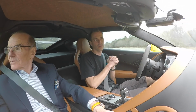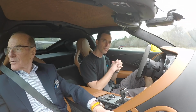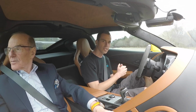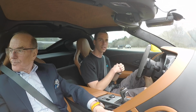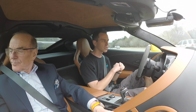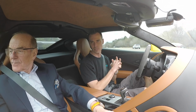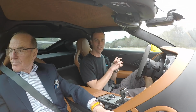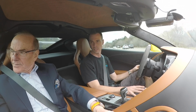The headers pick up a little bit, but when you don't turn the boost up much, you're really not gaining much from the headers. Just in my opinion, it just sounds 10 times better now. And then tuning it obviously helped tremendously. So we went from, I think, 607 to almost 670 to the tires, and torque is about the same. So we picked up about 60 or 70 rear wheel horsepower, 670 rear wheel torque, all while the car still drives like a stock car.